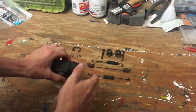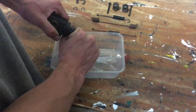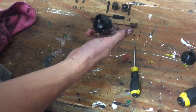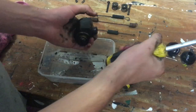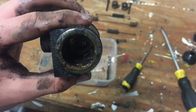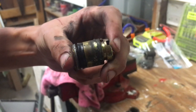Here are the wheel cylinders and brake drum parts and as you can see they look absolutely disgusting. We're going to remove these seals to get into the wheel cylinders, which I found extremely difficult — I just pried them off. Make sure whenever you do this that you're careful of your surroundings. With both outer seals off, I went at one of the pistons with the end of a screwdriver which compressed the little spring inside and then popped one of the pistons out. With the piston out we can remove the little spring on the inside. The other piston was still in there so I got a dowel on the end of a hammer and just popped it out that way.